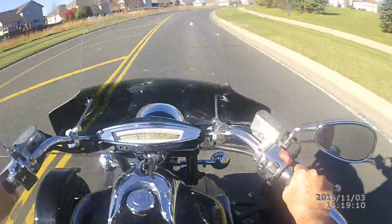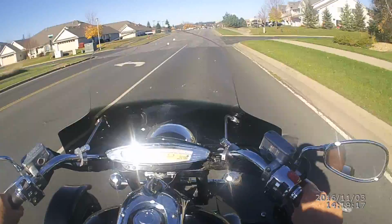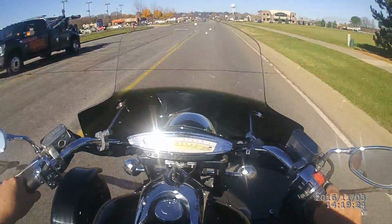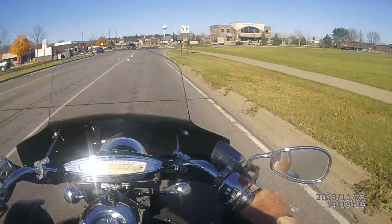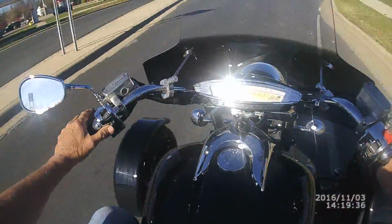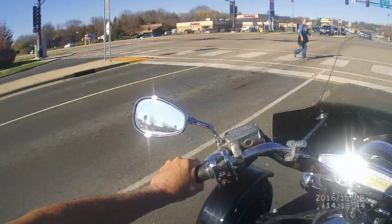On the trike conversion itself, it's a zero maintenance setup. The ball joints are all lifetime grease. Tie rod ends, everything is greased for life. Brake pad life on these should be about 200,000 miles. Running 3 on most of the trikes. I run 3 car tires, automotive tires, radials, and usually good for about 40 to 50,000 miles. And that's really an advantage if you do a lot of long trips. You don't have to stop and do tire changes.